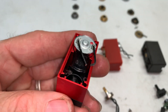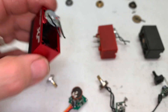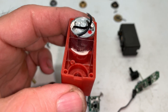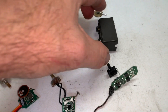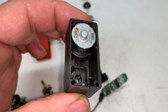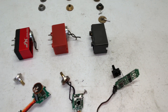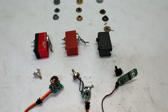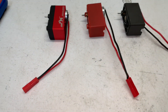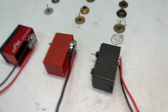The motor in the JX appears to be in there pretty well — I don't think it's going to move too much. The Redcat actually has some epoxy in it holding it in place, which is a good thing. For the Traxxas, I just added a couple drops of super glue down beside the motor, even though it seems like it's in position pretty well. Now it's time to put the JSTs on the motors — these little red plugs soldered directly to the motor tabs.